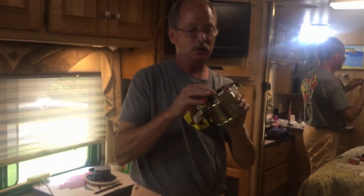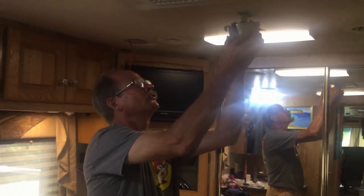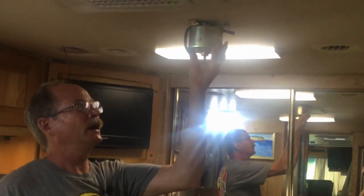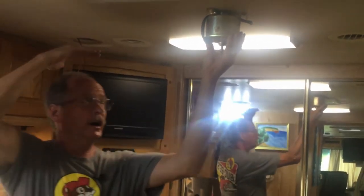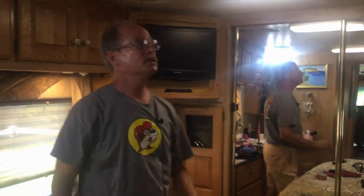This is the motor unit, and the fan I'm installing is a 12-volt unit, so it's going to operate off the motor coach battery. It's mounted with three screws that don't match any standard electrical boxes, so we're going to have to devise a system that allows it to mount on the ceiling and hang down. I did measure the clearance so walking underneath it won't be a problem, though it will not be perfectly centered over the bed.